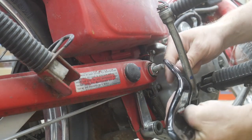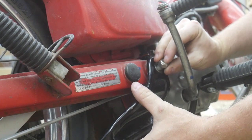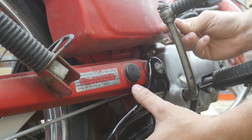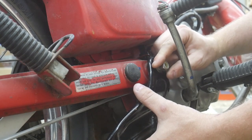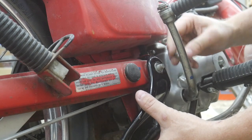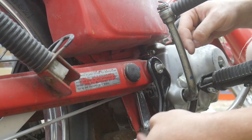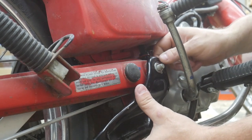Here's the spacer, here's the bushing, and I got a nylock lock nut. It's not the same thing that Honda offered, but I couldn't find anything that would match. This one might not match either - the thread might be off. This appears to be a coarse thread and that is a fine thread. So this will still have to wait. No big hurry because I'm waiting on my muffler anyway.